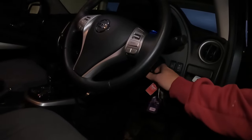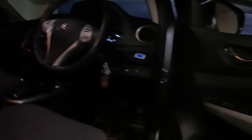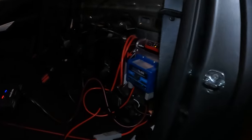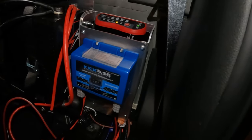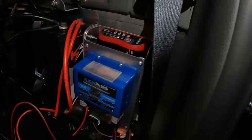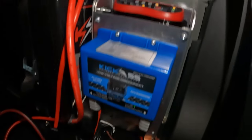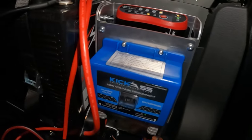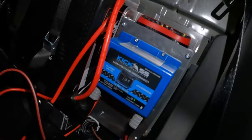Let's start the car and see if we can catch some fire. There's a solid alternator light — it means it's above a certain voltage. And now we're charging. We're getting 13, 14 volts — 14.4 volts — plenty of volts while the car is running. Guys, I think that is a job well done.